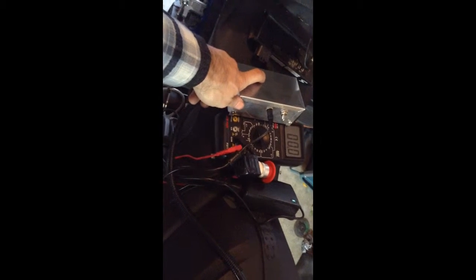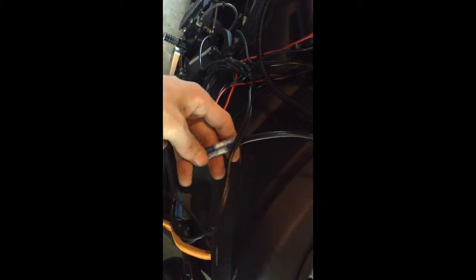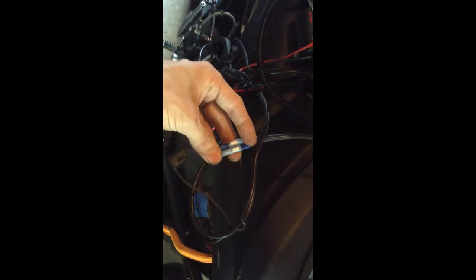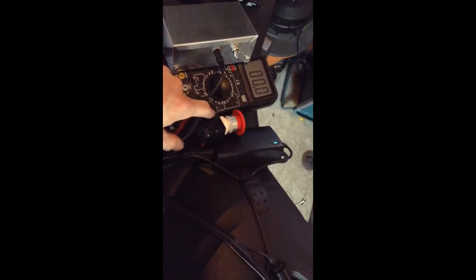Some concerns you might have: if you soldered stuff in here, you might worry about vibration — if it vibrates a lot, stuff could come loose. So what I've done is standardize all my connections with what I call motorcycle connections. Yamaha made these popular. If I have to on the road, I can cut the electrical tape and wire up a hard switch. That's obviously bad in some ways because someone could also wire your bike up the wrong way, so you have to hide things appropriately and make it hard to get to so they have to spend more time doing it.